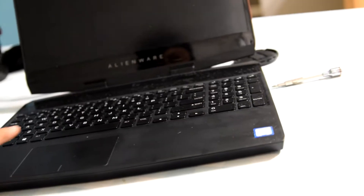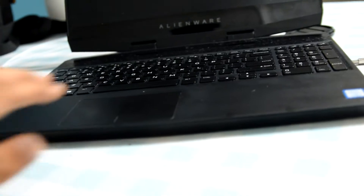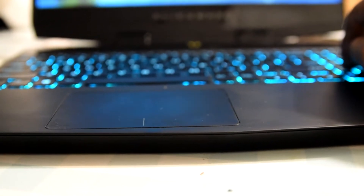Today we're not working on a car but rather my computer. I'm starting to have issues with the battery swelling. I had this problem with another Dell laptop before — the first sign is the touchpad becomes difficult to use. Right now it clicks fine, but once the computer warms up the battery starts swelling and bulges the touchpad out. This seems to be a pretty common problem among Dell computers, so I'm going to replace the battery before it gets worse and make a video about it.